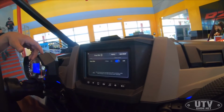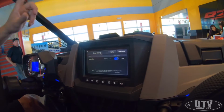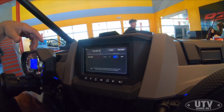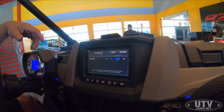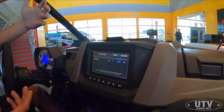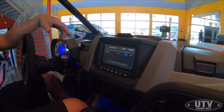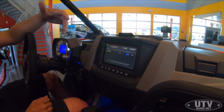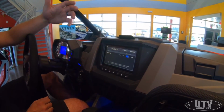And how's it connecting though between the vehicles? There's a sub-gigahertz antenna that's actually doing basically a small version of a network. So it's broadcasting out your position and then receiving it from other vehicles around you. Yeah, and the beautiful part is you don't rely on a cellular connection or satellite. That's awesome. So it'll work within, we say, about a mile or two in most conditions. Like out here where you've got line of sight for 10 miles, you may be able to get a few more than 2. But that's kind of the expected range you'll see in almost any condition.